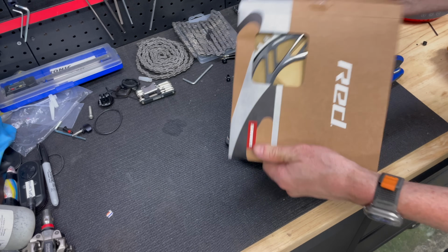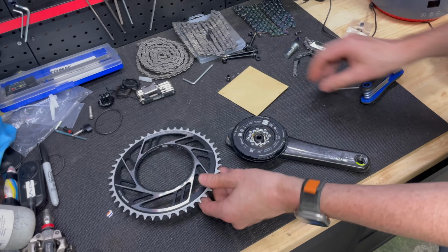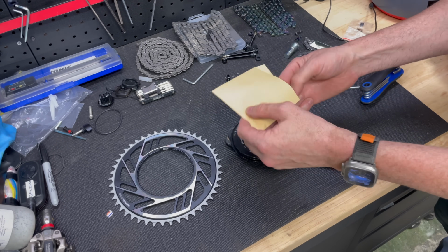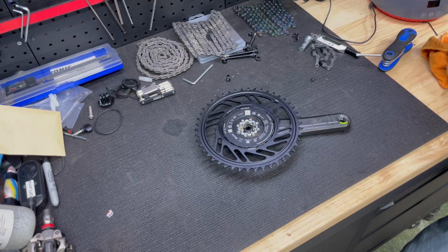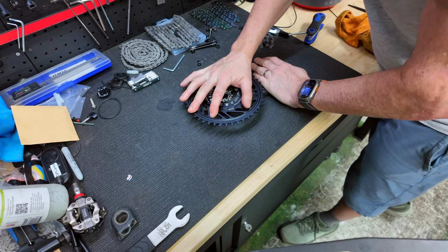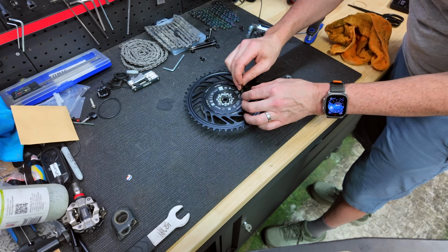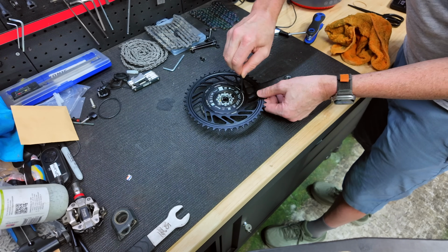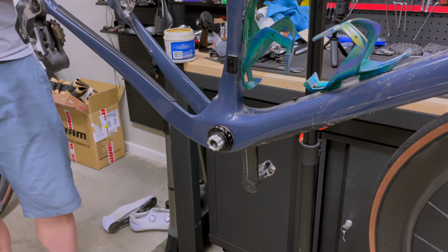Okay, chainring off, and as comparison, the 46 versus the 40, there's a few teeth difference there. Well, 6 to be specific. The tool also comes with a new securing pin if you don't happen to reuse the old one, which can be reused. And the full tightening of it will happen when you first pedal the bike. There's not a lot of movement in that at all. So once that new securing bolt is in place, I'll make sure everything looks nice and tidy.